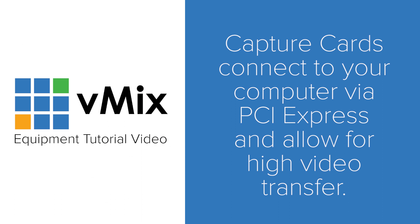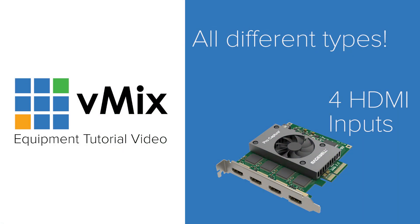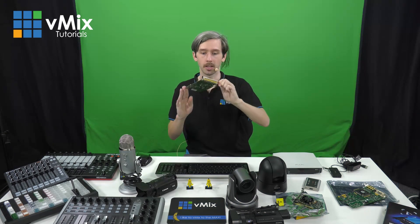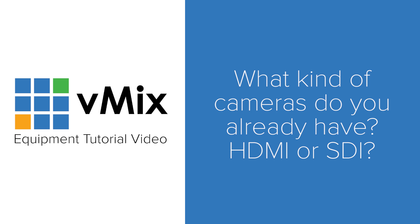You can also build or purchase your own external Thunderbolt device and use your own capture card in it. If you use one of these options you'll need to make sure that your computer or laptop supports Thunderbolt. We use this external Thunderbolt option for our trade show booths as it's easy to bring along a laptop and the AJA IO 4K and know that we're going to have a rock solid four camera HD production. Now the most common way to input SDI or HDMI cameras into a computer is via a capture card, which connects to your computer's motherboard via PCI Express for a super fast, super high data transfer connection. These cards come in all shapes and sizes but will typically look something like this.